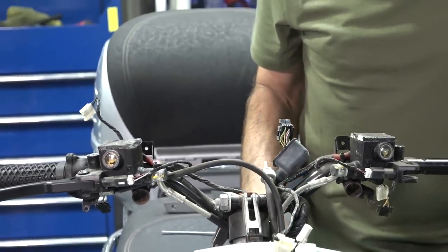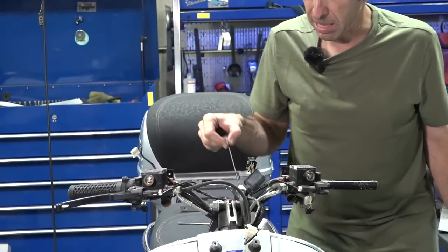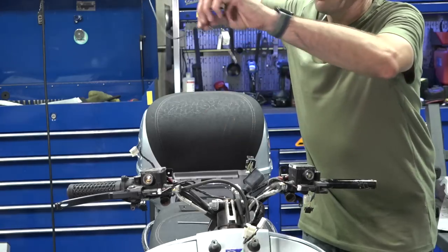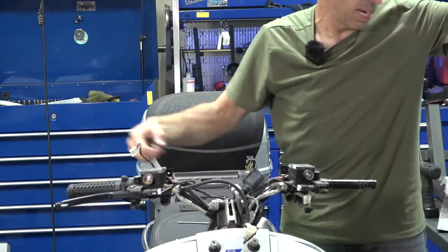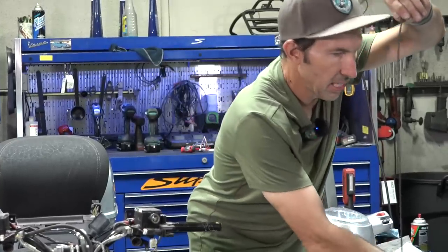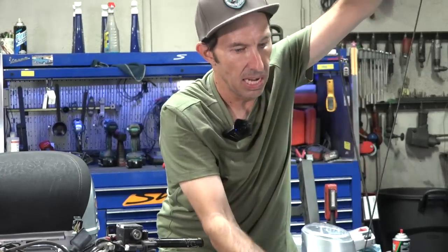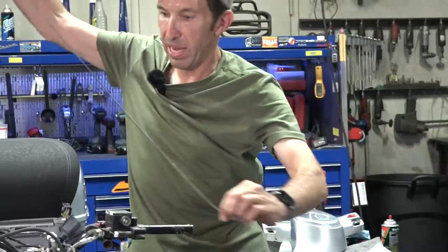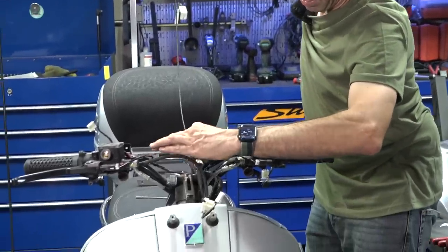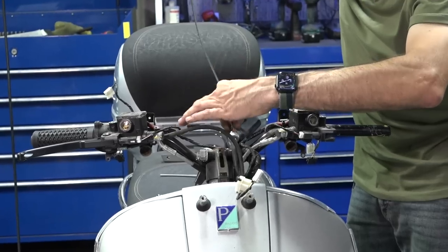There's one more thing to do with grease before we put it together. When I was riding, the speedometer needle just flutters — it looks like a wagging dog tail. Usually the cable isn't broken, there's just no grease. I pulled it right out; it's got a square end on the bottom. Take a small amount of grease and coat pretty much the whole length with a really thin coat. Don't put too much grease towards the top or it will wick its way up into the speedometer assembly.